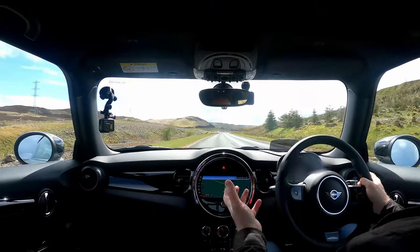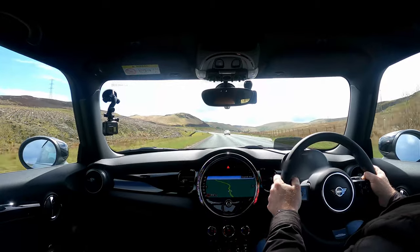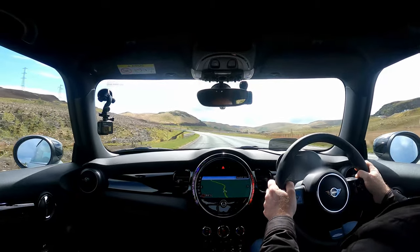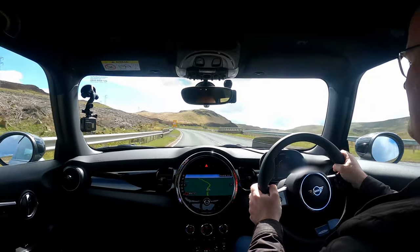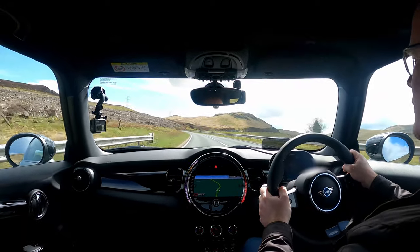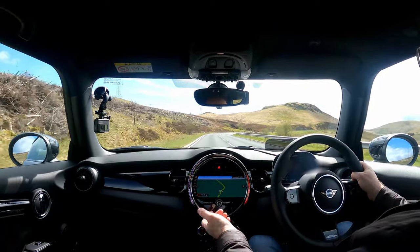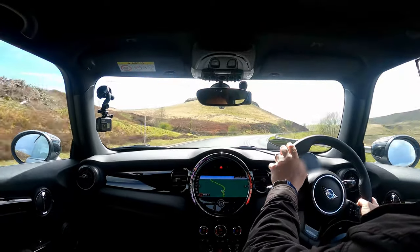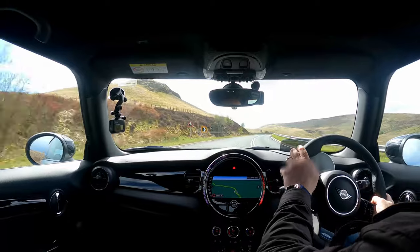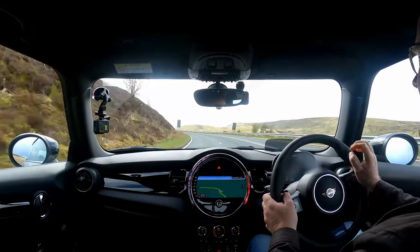There is a no-cost adaptive damper option. We didn't opt for that - I'm not a huge fan of adaptive dampers, I just like a nice passive setup. We didn't opt for bigger wheels either, because I prefer the smaller wheels. The slightly higher sidewall on the tyre just gives it a better drive, allows you to feel the car at the limit a little bit more, and makes it a little bit less snappy.